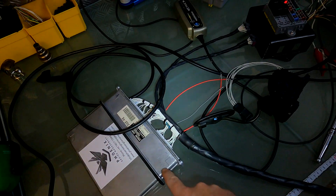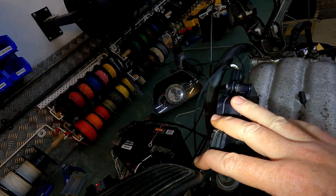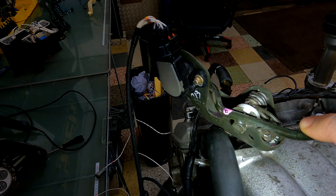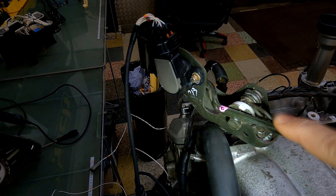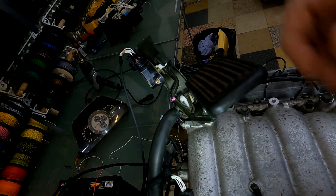At the moment we've got a 3UZ all wired up on an engine here. We've obviously got our throttle body on there, and what I've done is I've put three different pedals on. I've got this one from an IS-250, which is the one that we normally supply if you guys don't have your pedals. We've got this one which comes from a GS-430 or an SC-430 — they're the same — but you get a similar one on the LS-430, just a slightly different pedal. It's got a long piece that comes down and bolts onto the floor.